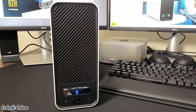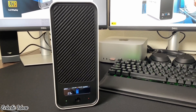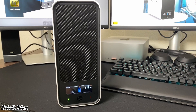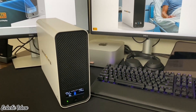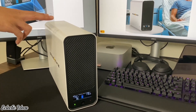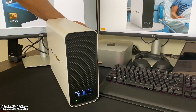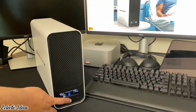After plugging into the wall outlet, we still have to power the UPS on by pressing that middle button. Once you press it, you'll hear a beep, the green light will come on — just wait a little bit. Since it's plugged in, it's going to fluctuate a bit. We're seeing 114 on both sides, then 113. This readout is showing what's coming from the wall outlet, since nothing else is plugged into the UPS yet.